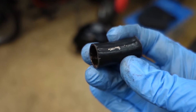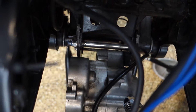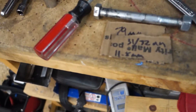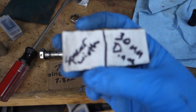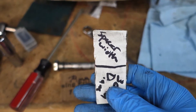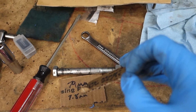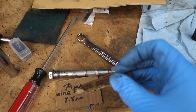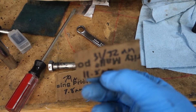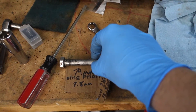So we're going to run down to a metal supply shop and find something a little bit better suited for it. I took some cardboard and cut out the dimensions that I need. This is my spacer width between the plate and the engine case. It's a 30 millimeter diameter for the outside diameter of the tube I'm looking for, and it's 31 or 32 millimeters long. The bolt running through it is 11.8 millimeters in thickness.